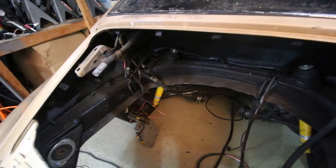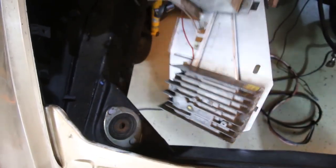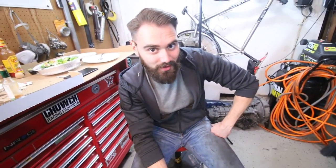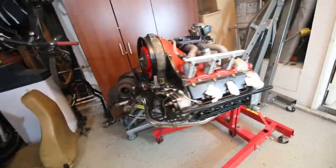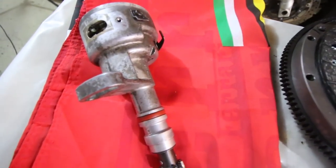I have no idea how long this video is already. This is just a lot of us talking about what needs to be done to get this to work because we're planning this in real time — we post videos typically the same day we film them, so it is day 15 or 16. This box gets replaced with the MSD — I think we're switching to the 6AL. We have the other one that has ignition retard capabilities but we're not going to need that if we go with MegaJolt or MS2, so we're going to return that and get the 6AL. The garage is clean, there's pizza, and we have a clear direction. Basically the engine is done — it's complete — we just need to figure out what to do with the ignition. That freaking distributor is the reason why this isn't in the car right now.